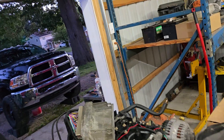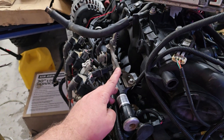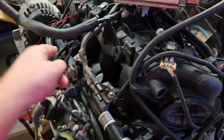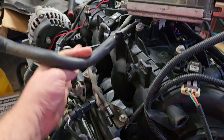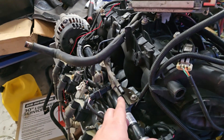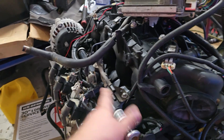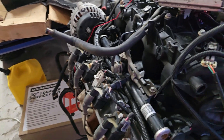The other reason is the fuel rails. This is what we call a return-style system. The top line feeds in and pressurizes all this. This is a regulator referenced to manifold — it'll do 15 PSI guaranteed. All you have to do is hook your fuel lines up. This is a return. I run them dash-6 on both and it works fine for me. I've never made more than 700 at the tire on an LS.